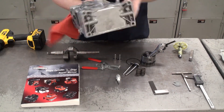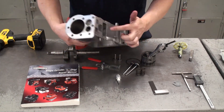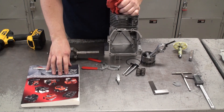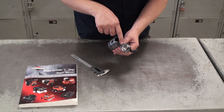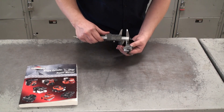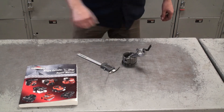The intent of this video was to show you just a few basic measuring techniques. For all other specifications and measuring techniques, please refer back to your manual. One thing to add: make sure you measure the large bearing on your connecting rod — use the digital vernier caliper and measure the interior diameter with the backside of the caliper.